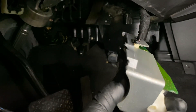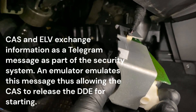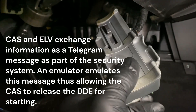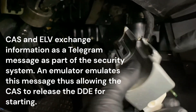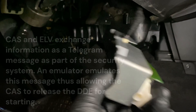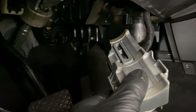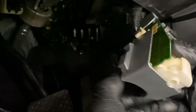There are two problems with this. First of all, even if you could take this off, if the circuit board and circuitry doesn't send a telegram message - and I don't mean the social media app, I mean a telegram message to the CAS - it won't allow the engine to start. So not only can the lock fail, but you can have an issue with the circuit board or the wiring in between. The fault is intermittent and it's been doing it randomly.